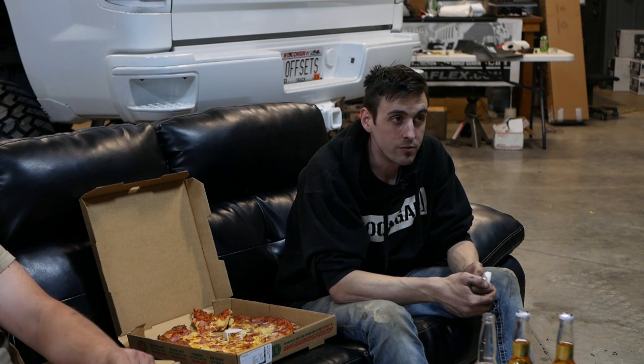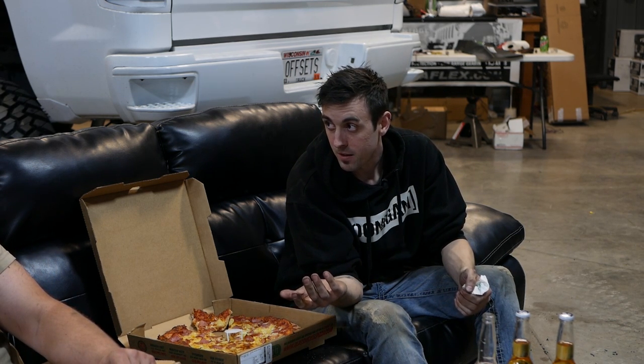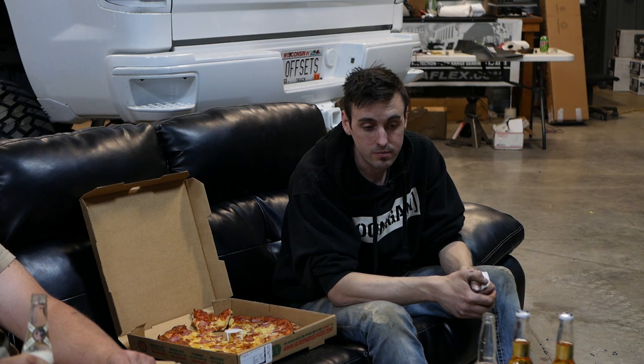You're not going to get away with it just because you have a newer truck. I was at Cody's shop yesterday — he's putting lower ball joints in his 2014, and they went bad already with stock tires and just a leveling kit. So don't always expect your vehicle is in perfect condition when you get a lift kit, because sometimes you will need to replace factory components in order for the lift kit to go on properly.